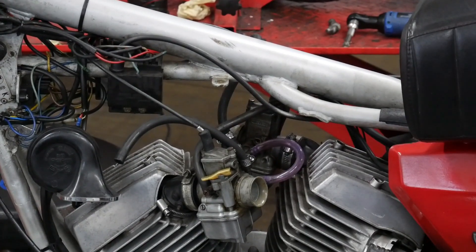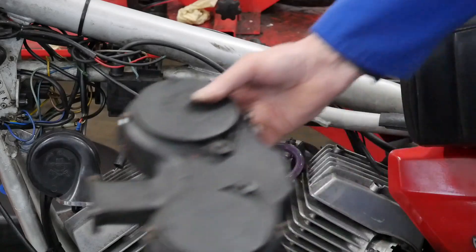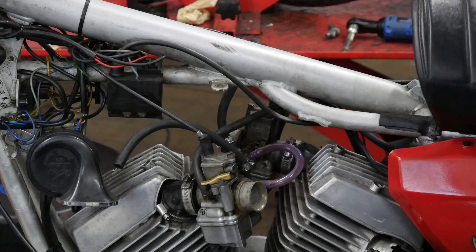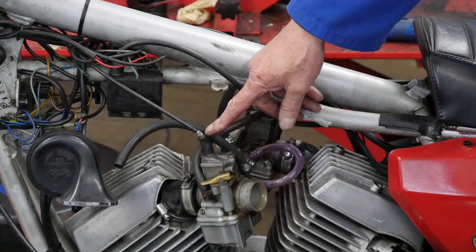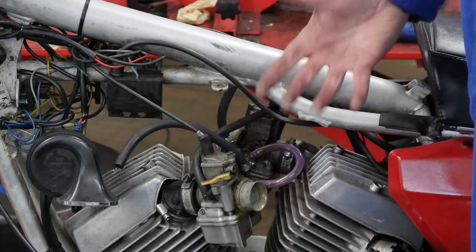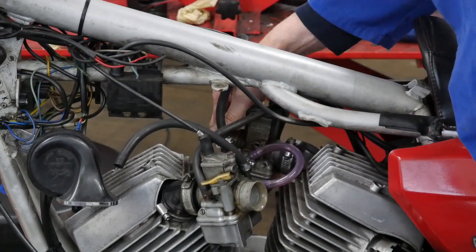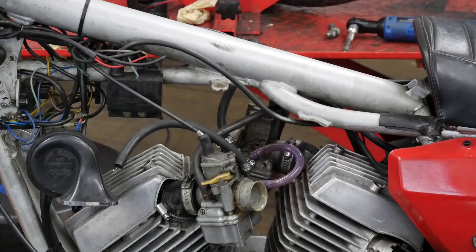This is the air filter, which is a lovely piece of kit - I've removed it to get to the carburetors properly. And I hope you can see in the video - that's how I found the cable. What's interesting is somebody's adjusted the other side to make up for it. You can see one side is moving and this one isn't moving at all, so it's pretty obvious that it's been kind of messed up for some time.